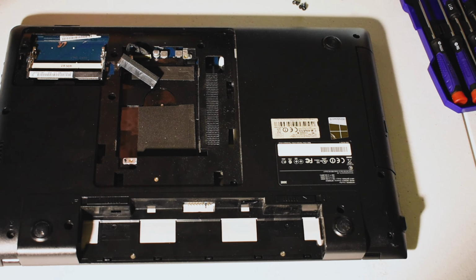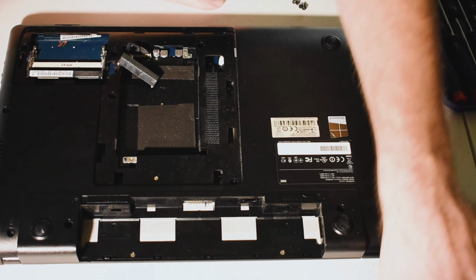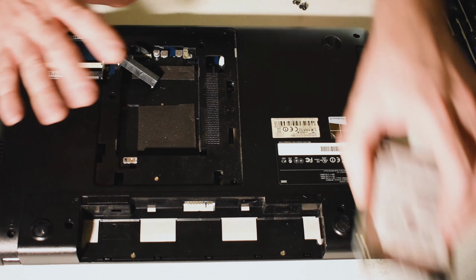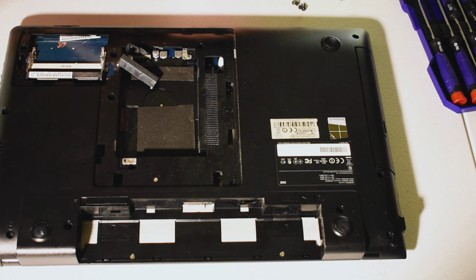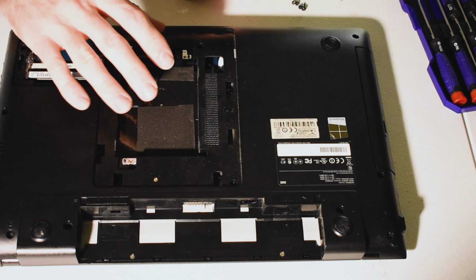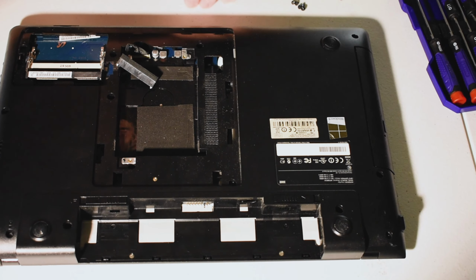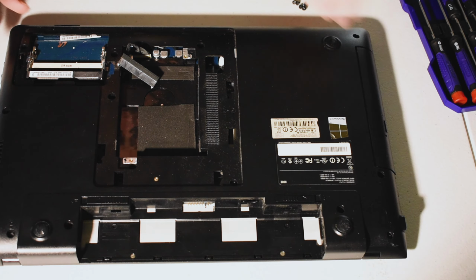Now, it is important, if you have an external drive and if your computer's not dead like this one is, to go ahead and make a full backup, a clone of your operating system and all your important files. That way, once the new drive is in, you can plug in the external, reinstall Windows, and then restore from that full backup. That's going to put you basically right back to where you were before. Like I said, it's going to be quite a bit faster.